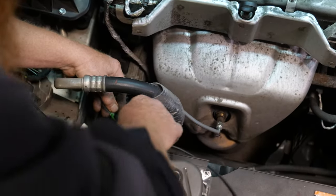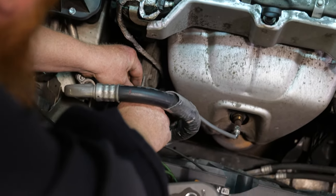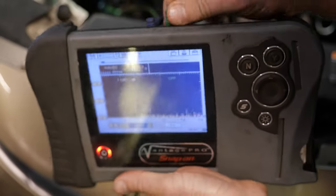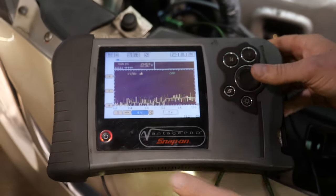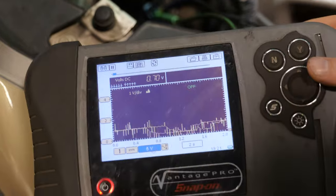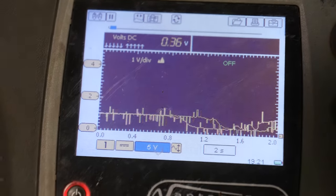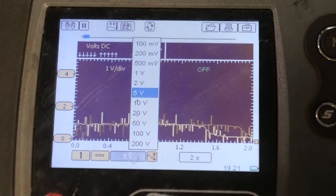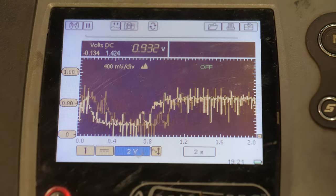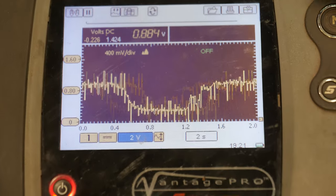We could have shown you guys this on the Vantage too. I'm glad Danner's doing this because it kind of scratches an itch. We're just backwards on our polarity. Let me switch these here, because we went positive to the ground. And then that's your O2. This is what the computer sees. Let's change this voltage. Right, there's your normal looking O2.